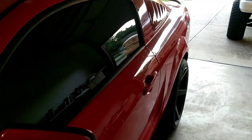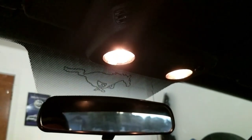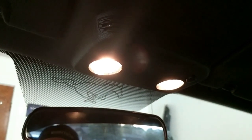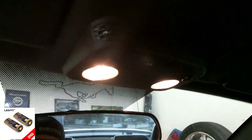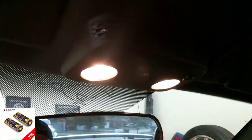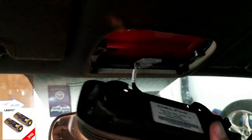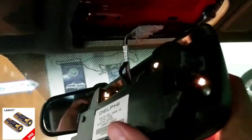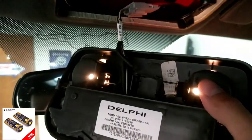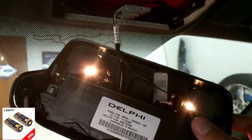As you can see, we've got the regular basic halogen bulbs in here. We're going to pop those out and put in one of these T10 bulbs to see exactly what the difference is. On these Mustangs, the dome light cover just pops right off - it's clipped on to the headliner with little clips. Pull it and it'll pop right off so you can get to the 194s on the back side of the dome light housing.